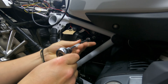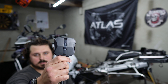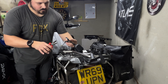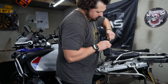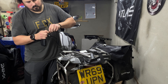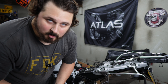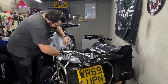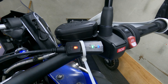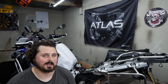With the battery now disconnected, we move onto the next part. We've got positive, negative, and then the accessory — yellow is the accessory. On the right hand side of the bike we're going to see this plug here — this is what we're going to use to tap into with the T connector. I'm going to disconnect this, strip some of the sheath away, and find the right cable. There are four cables going into this and we want the blue one running down the centre at the back. The blue and red cable is going to go into the front of the T connector and then the yellow accessory is going to go into the back.